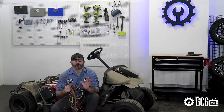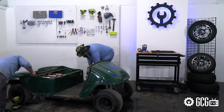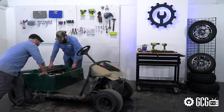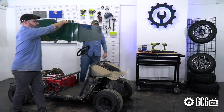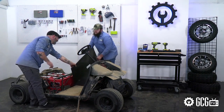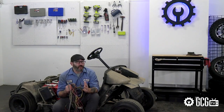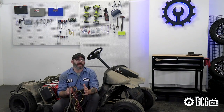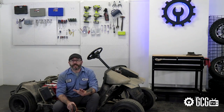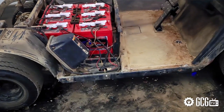Time for a quick reality check during teardown. Condition of the vehicle you choose can have a dramatic impact on success. With a 15-year-old EZGO TXT that was used as a golf course service vehicle, we're running into a fair amount of rusted hardware and steel rivets that we had to drill out to remove. Reattaching these points can require a run to the hardware store for hardware, rivets, and an applicator. The light package had been long disconnected but left in place, so we also spent some time carefully reverse engineering and removing the wiring harness, voltage reducer, and fixtures.